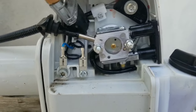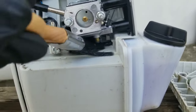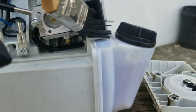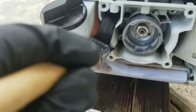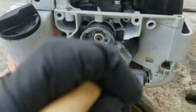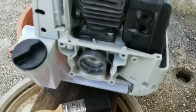Once the machine is saturated with solvent, use a paintbrush to get into areas where your fingers may not reach. Just brush the dirt out of all areas where it can be noticed. This is the preferable way for cleaning the complete machine.